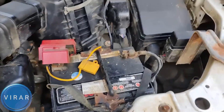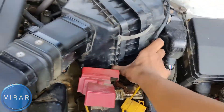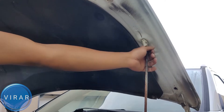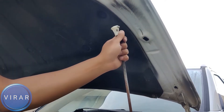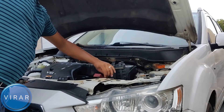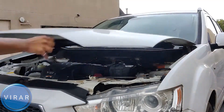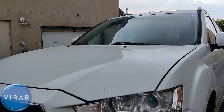Now the filter is in place, it's not moving, it's not going anywhere — and that is pretty much it. In order to close the hood, push the hood up, get some stress off the prop rod, get the rod out of the hole, and put it in its place. Once that is secured, lower the hood and slam it shut.